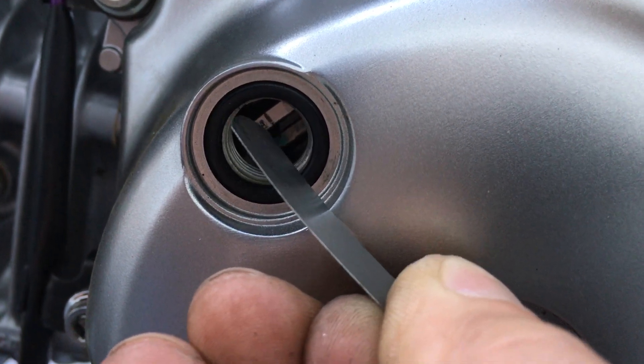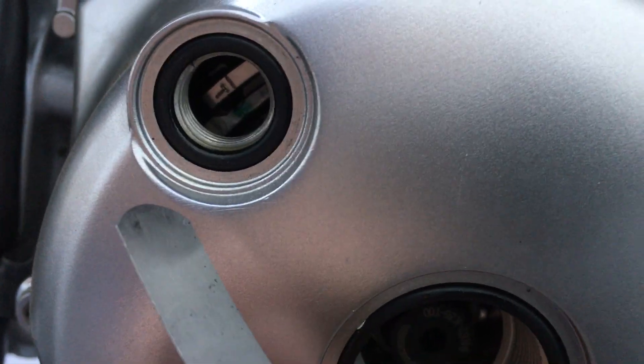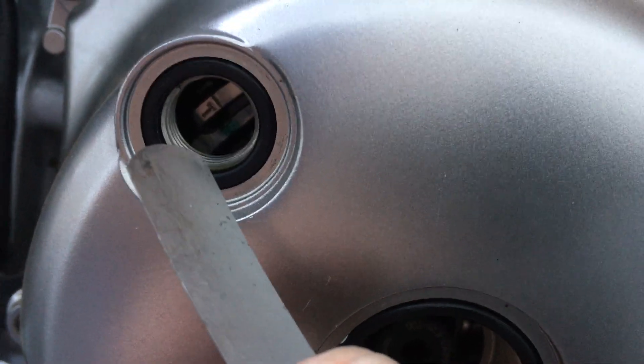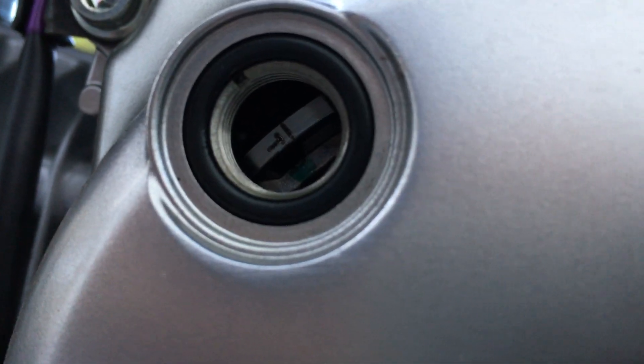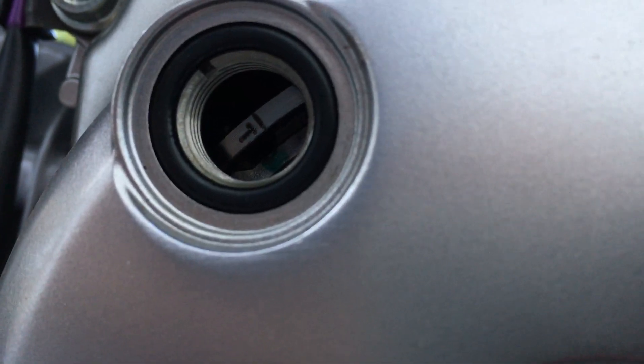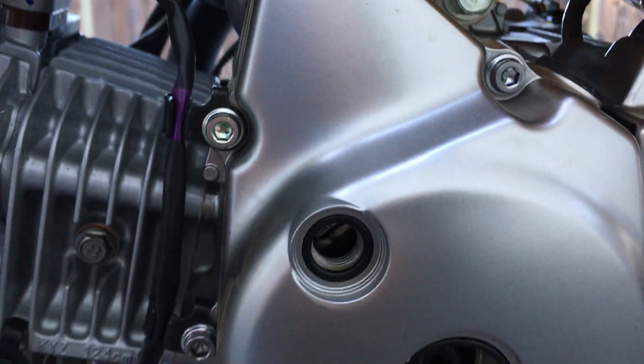There's a little groove right there. Line the slot of the T — you can see on the top of the T there's a little line — line that up with the groove on the female thread. You can see that little groove right past the o-ring at about the 10 o'clock position. Line up those two and that's your timing mark — that's your top dead center.